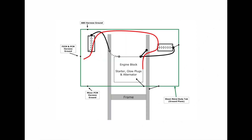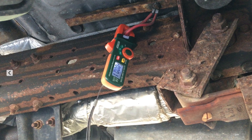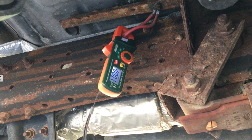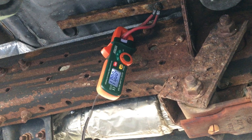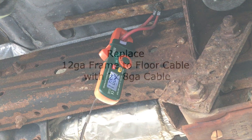Going back to modifying the layout to improve my truck's voltage readings, which was the initial goal — I mentioned in the earlier video that when I found the lower bonding cable burned, I replaced it with two 8-gauge cables, essentially a 4-gauge cable due to parallel 8-gauge cables. So I need to see what I caused by doing that.